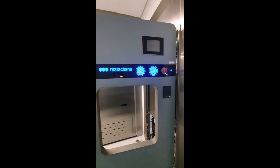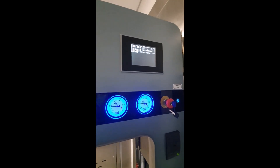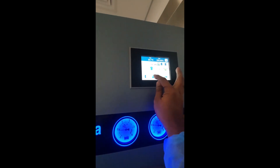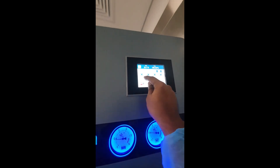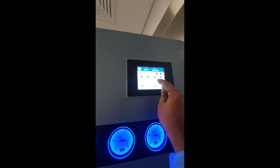I switched the machine on again from the inside, went to the main screen, and switched it on from the outside by pressing the outer on button. Once the machine is on, you can log into the service mode and switch off the steam generator — this is another option to isolate the heaters and supply power to them individually.